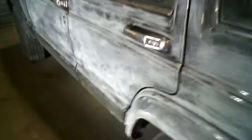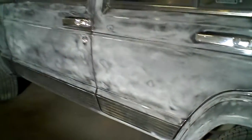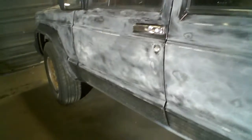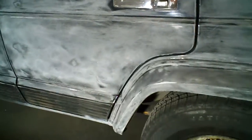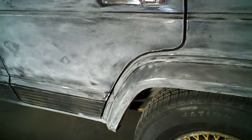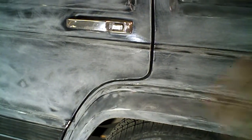Moving forward, this is why I've got so much work now. You can even see in here where it's just caked up — this is the kind of stuff I've got to get to. So I'm doing a lot of sanding right now, just to bring this thing down. I'm knocking the body down with 80 grit to get rid of all that caked-up paint, but even with the 80 grit it's still struggling to get all this stuff off.